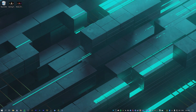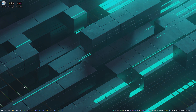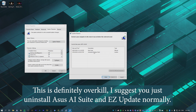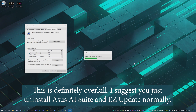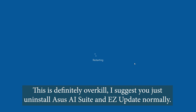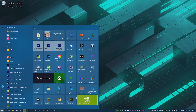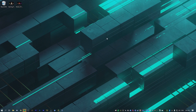Once you're back into Windows you may notice two little icons from AI Suite and Easy Update. This is completely optional, but I like to remove these when done. Go back to Create a Restore Point, this time go into System Restore, hit next, and restore back to our 'boot logo' restore point — that should uninstall these two programs. It may take a while, possibly up to an hour. It will keep your boot logo changed and won't affect anything in the BIOS — it just removes those two programs from Windows. Once completed, these two pieces of software will be gone, and you can delete the two downloaded files from your downloads folder. That's it — you've changed your boot logo.